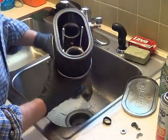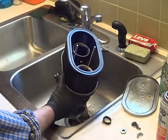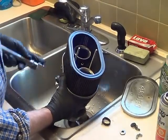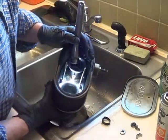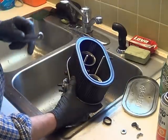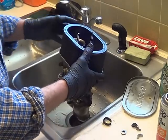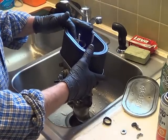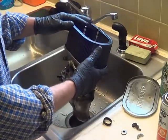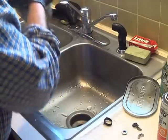This is about as far as you want to take it with the Dellorto. If you need to get to the idle jet, there are two main jets and two idle jets in there, and we covered that in other videos. Just leave the filter in place — if it's out in the open it's easy to do, in a sedan it's easy, in a Karmann Ghia it's a little harder depending on what kind of vehicle you have.